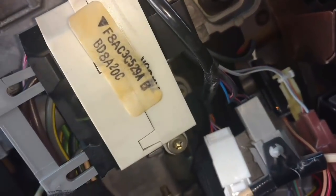Alright, I came over here, massaged the steering column back in place where all 4 bolts will come through. Don't forget this rod right here has to go under that bolt. And now I'm going to go ahead and tighten all 4 of those down.